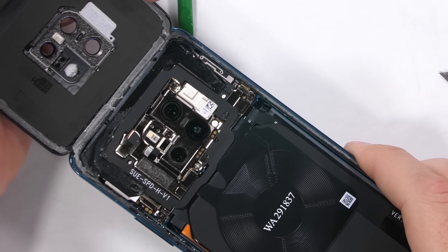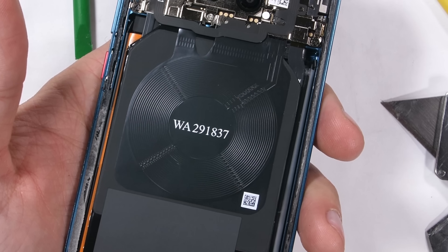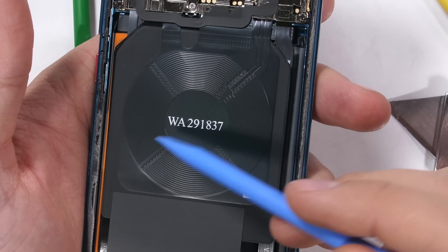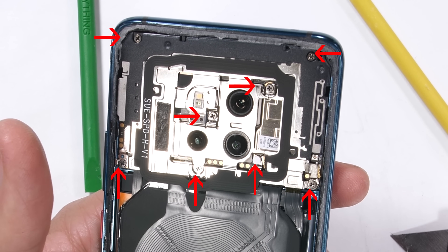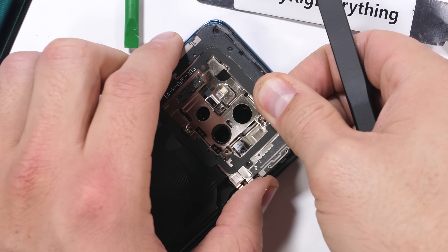Revealing the rather aesthetic insides of the Mate 20 Pro — a clear version of this phone would be pretty phenomenal. Metals cover all the inside camera units, and the thick copper wires can receive and emit wireless charging. Super impressive. There are 8 screws surrounding the top metal plate. I'll keep these organized as I set them off to the side. Toolkit's in the description.